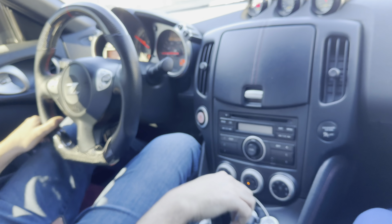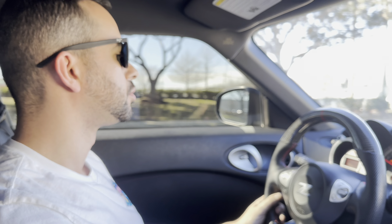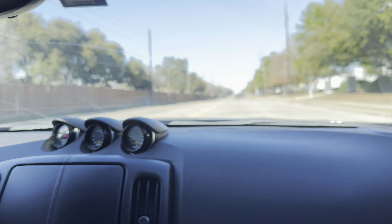Usually we'll drive the car, give it a little bit of load to check fuel trims as RPMs increase, and then do a full throttle pull just to kind of feel it out. Driving the car through the gears normally, shifting at around 4,000 RPM with light to medium throttle, going through into fourth gear to get some speed, and then doing a gentle sweep upward. Then if that checks out, we'll do a full throttle hit. I usually ask for a third gear pull, but we'll start in second this time. That was only about 13 pounds of boost, but for the purpose of this video I'm not really stressing it too much.